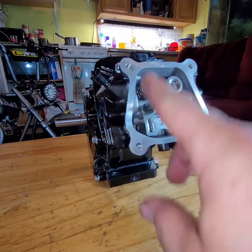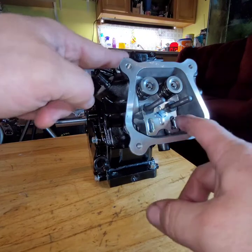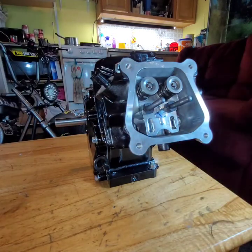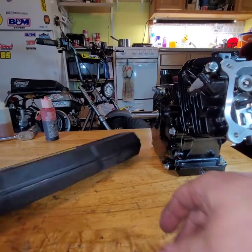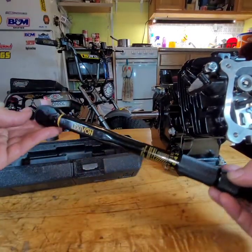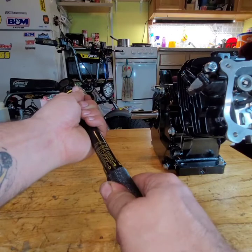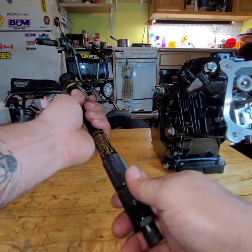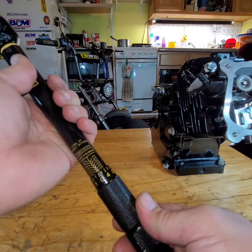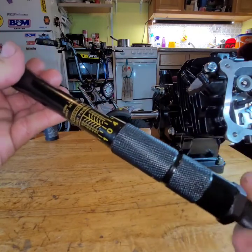Let's do the head first. These could be 200 inch pounds, or I believe 25 foot pounds. We're just gonna do 25 foot pounds because I got another torque wrench that I just bought. This thing's pretty sexy. Amazon. This has foot pounds on it. So I found when I was building a 301 for somebody, I did not have anything in foot pounds, and all the specs for that one were in foot pounds. Can't really see because I'm using a shitty camera, but it's set to 25.